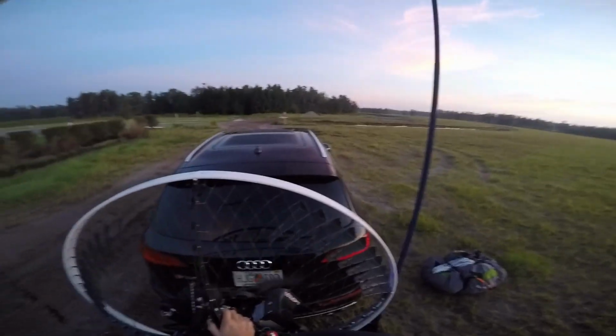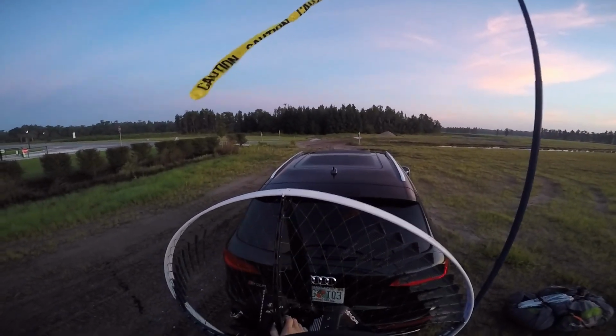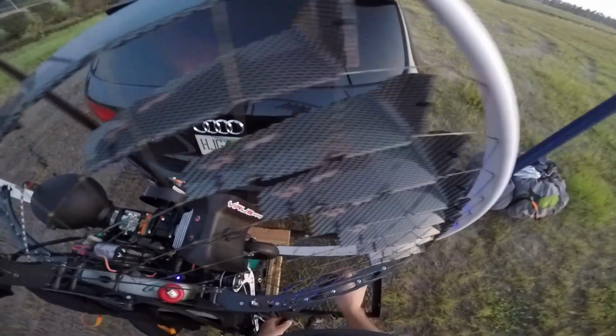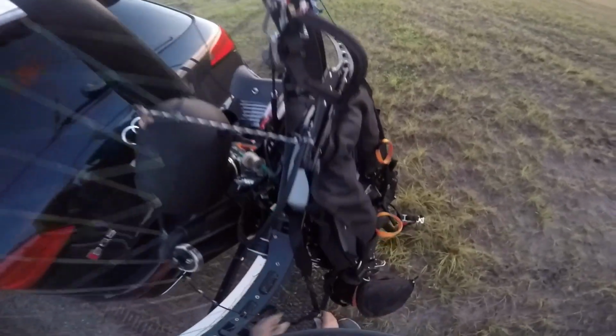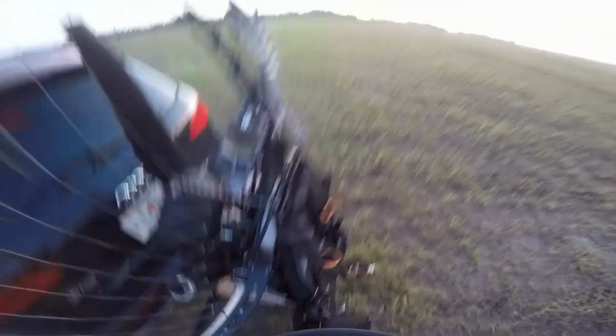All right, that's going to be good enough. And we'll do a full throttle, full speed shot right before we get ready to go. So that is not the entire warm-up, but that's just making sure that it's good to go. Put a little heat into it before we start it and run it up to full throttle. Make sure all your straps are off, everything's clear. That looks good. Buckles are loose. Yes, that looks good. Ignition switch remains on.